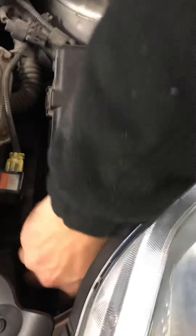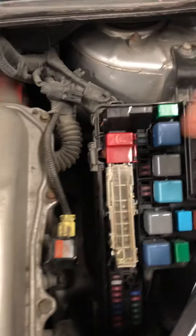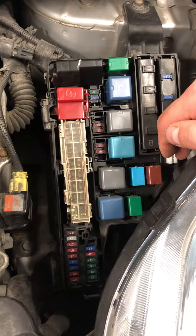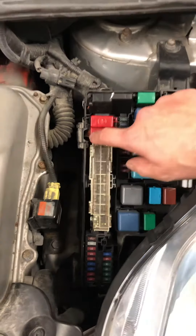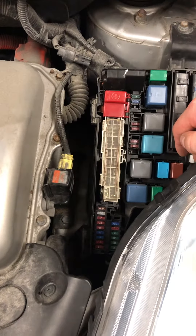I'll show you in the engine compartment where I measured the battery voltage at the main fuse box. If you lift up this lid, you will see the battery terminals from behind, from the trunk, because the battery is placed in the luggage compartment. On the fuse box terminals I also measured about 10 volts, but at the battery itself I measured 12.4 volts — so the battery was in good condition.